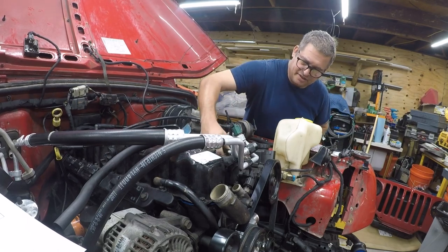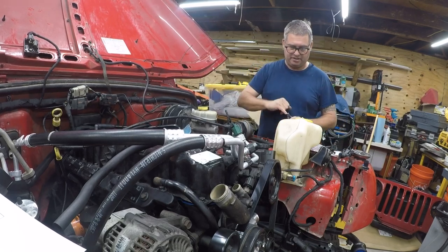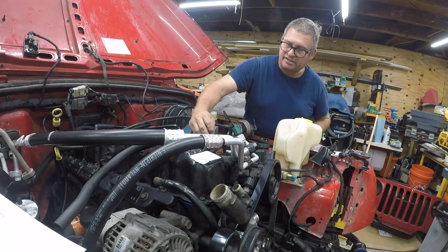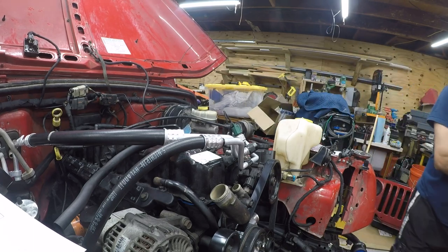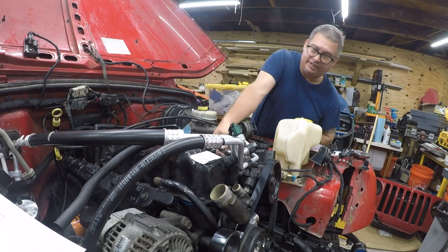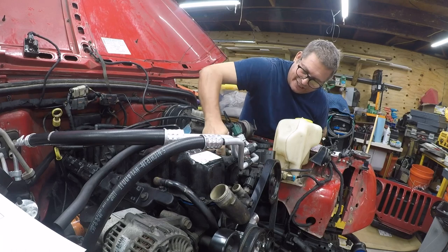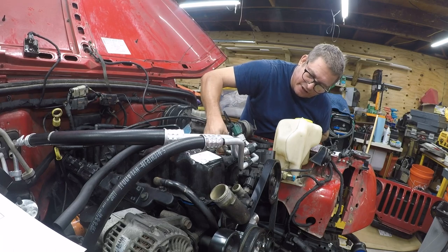Pressure sensor. And that's where that used to be. So we'll lube it up. And it has two connectors. So the new one has three. That isn't going to work. So I'm just going to use the one off the old one. I don't think there's anything wrong with these sensors, but the ones from Rock Auto clearly don't fit. Okay, so here's a great example of where it pinched the O-ring.